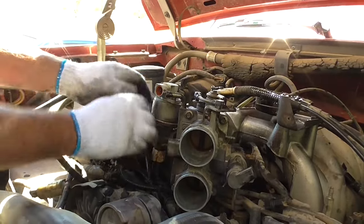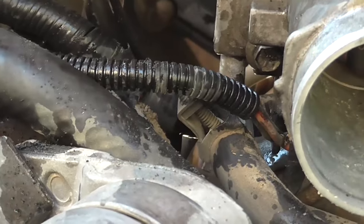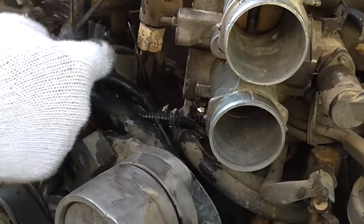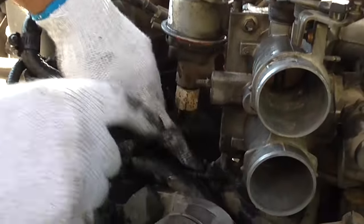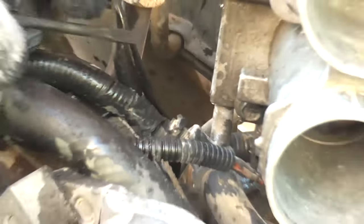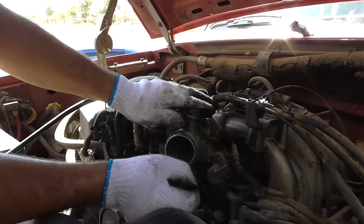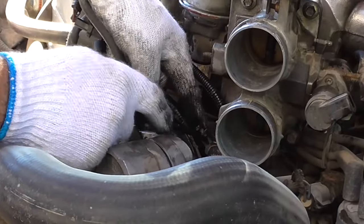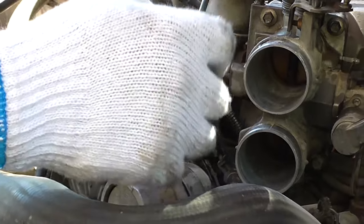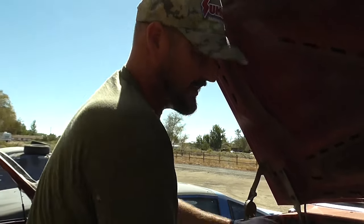It looks like I'm going to have fun with this bottom water clamp because it's got a unique clip. It's not like a typical adjustable clamp — this is a one-time use. So I'm going to have to replace it with one of these easy-adjusting hose clamps, because the factory likes to use the other kind, which is a nightmare to take on and put back on again. I'm going to remove that and the rest of these bolts. I'm going to remove the mounting bolts and this cooling line, then make a pause and take the throttle body off the rest of the way to show you how to change the sensor.